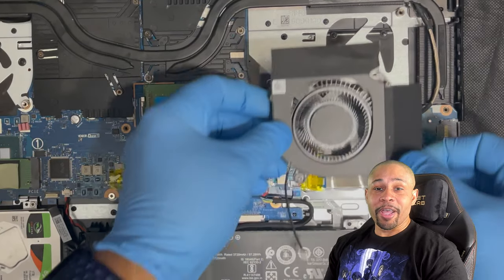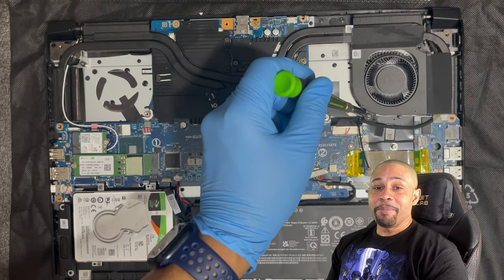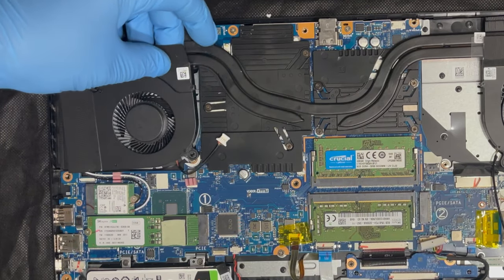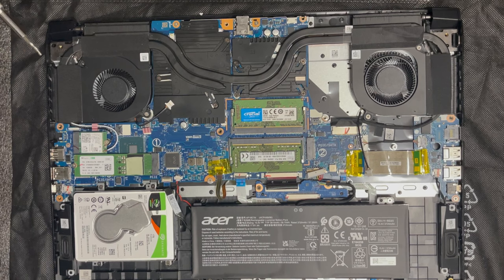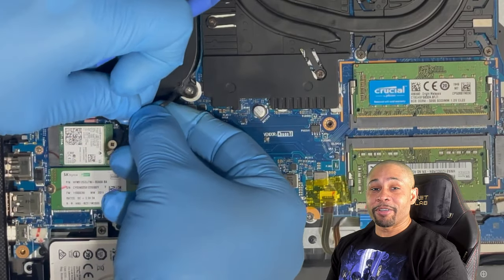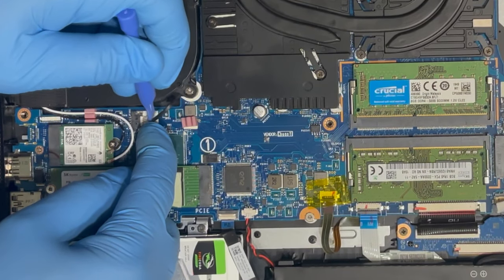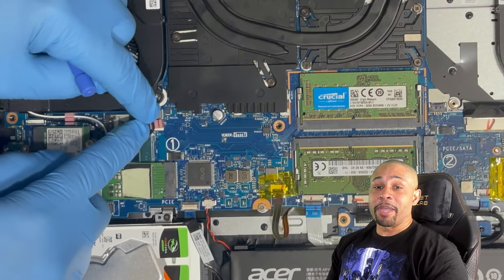When finished, go ahead and retrieve the CPU fan. Fit it in place and replace the screws. Do the same thing for the GPU fan. Plug in the GPU cable into the connector on the board. You may want to use the pry tool here to help push it in. Put the cable in the pink organizer.